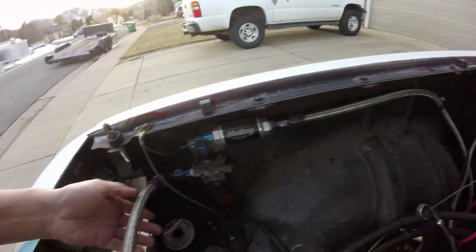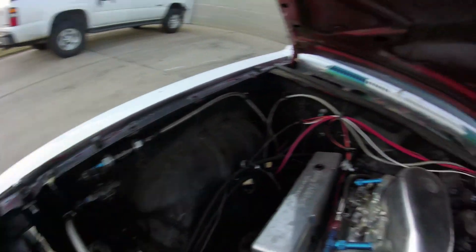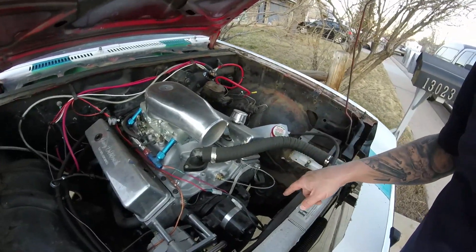This one does have a title. Eventually it'd be nice to have the thing back on the road, but the side impact beams are all out of the doors — it's just kind of a death trap, to be 100% honest, even though I did drive it from 1997 until probably 2001. But whatever, I did it. So this is the deal — it's got a Holley fuel pump, dash 6 all the way up to here, and then dash 8 up to the carburetor. Just a cheapy Holley regulator and Holley fuel filter that used to be on the Malibu that I repurposed. The carburetor is off my buddy Steve's friend Gabby. The intake I bought new, the heads I bought new, the cam I bought new, the balancer I bought new. Other than that it's used — just used cast piston stuff.